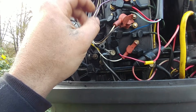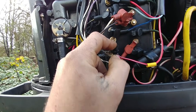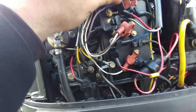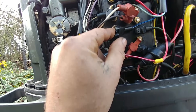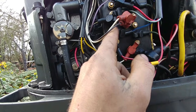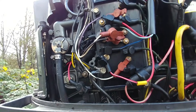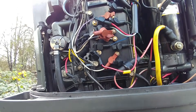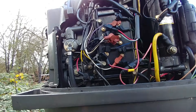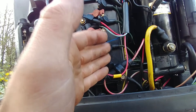What I did was I tested voltage coming from the stator on these terminals. The red ones, you're going to have like 30 or so volts AC, and the blue ones you're going to have like 180 volts AC — 130 is still good. So I knew I had good juice coming in; I just wasn't getting anything out of these two.